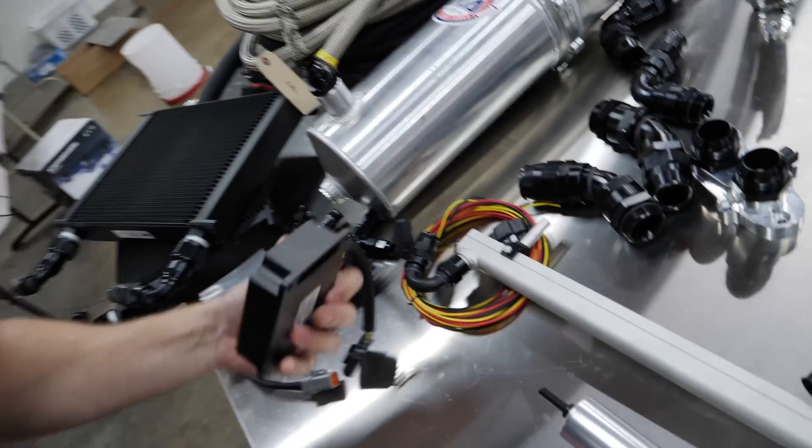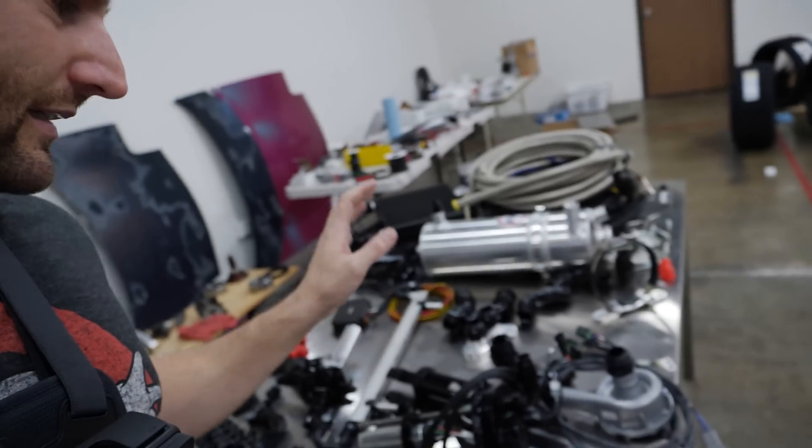One of the biggest components to that setup is this right here. There are two of those — each of those control the pumps. Because one of the biggest problems with this level of fuel delivery is fuel temperature. If you heat fuel up, fuel will vapor lock. It turns into vapor. The only experience I have with temperature and pressure of a liquid is coolant. You want pressure so that it raises the boiling point. Well, for fuel, that's a slightly different case. When you get it up to about 160 Fahrenheit or so, your fuel can vapor lock.